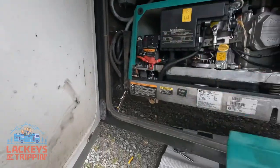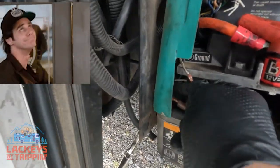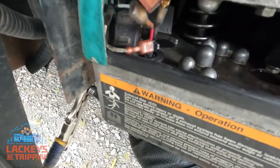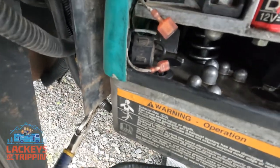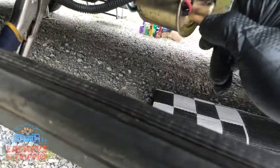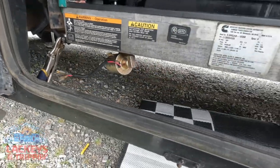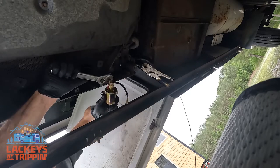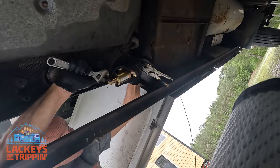Take a look at where that fuel line is — wait, I was getting ahead of myself. Go ahead and disconnect those wires first, move back down underneath, pull the wires through, and now here's where we disconnect that remaining fuel line. This is where the adjustable wrenches come into play. Put those on there and twist the fuel pump off — don't twist the fuel line, twist the pump, because the line is stationary.